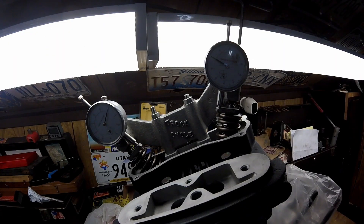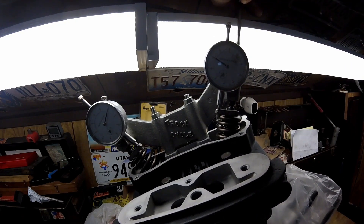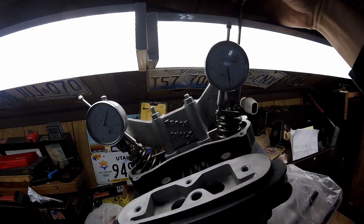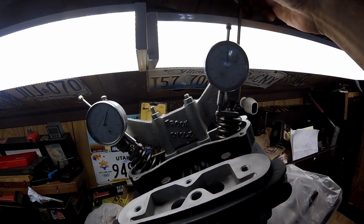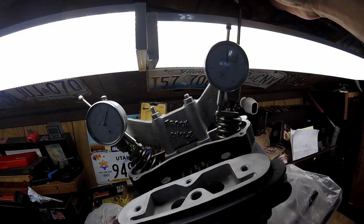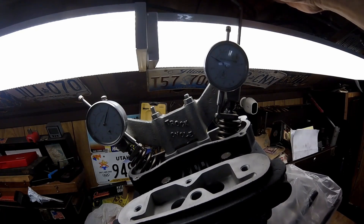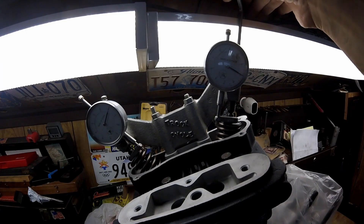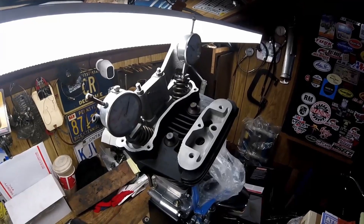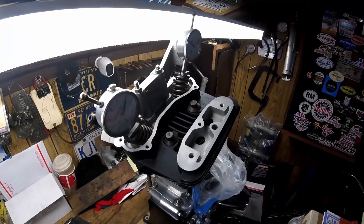Now the intake — it's open to 0.182 at top dead center. One revolution is 0.1 — 10, 20, 30, 40, 50, 60, 70, 80 — there's 0.182. Going to zero and beyond, that's 20 more plus one full revolution of clearance — more than enough, even with no gaskets. The gaskets are going to give me even more clearance, so I'll stop there knowing I have more than enough clearance from my valves to my piston. That's how you check valve-to-piston clearance. Don't forget to like and subscribe, and if you have any questions drop them in the comments.